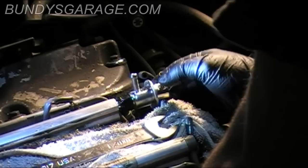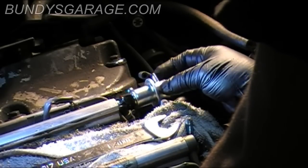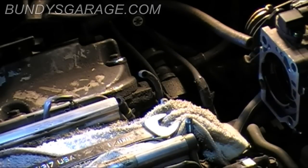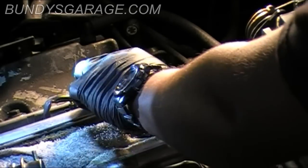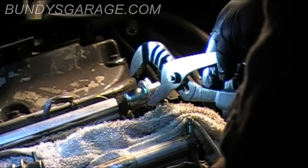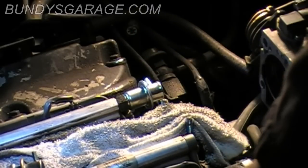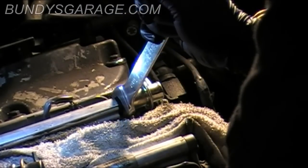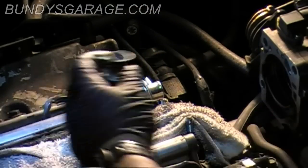And so I can move the nut forward and have it contact the fuel rail sooner, but then I don't know. What I ended up doing here is, here's a new one, here's the old one, and I screwed it all the way down. It was just a smidgen off, so I basically took a pair of channel locks here, put it here, and just tightened it down just a little bit, and got it to rotate. Then I put the wrench on here to snug it up, but it's already snug with the rotation of this, so everything looks like it should fit now.